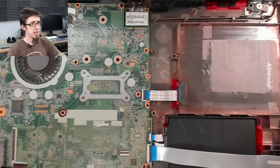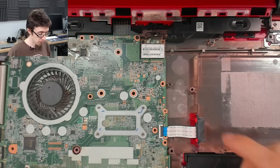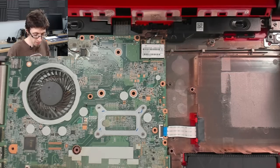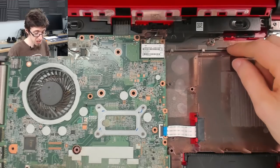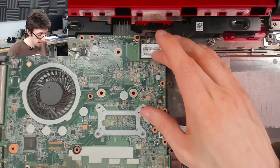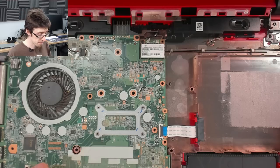So the root cause of these things having abysmal Wi-Fi is that there is just a single antenna there. That's the issue, and with a bit of fettling, we might be able to get that Wi-Fi up a little bit. It might be there's a break in the Wi-Fi antenna cable somewhere that's causing it to be that bad. Other drivers may also improve it, or even a different card. However, the easiest way to really resolve this problem is to stick in another Wi-Fi antenna.